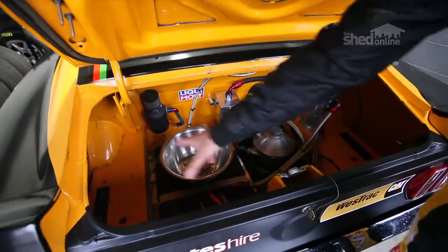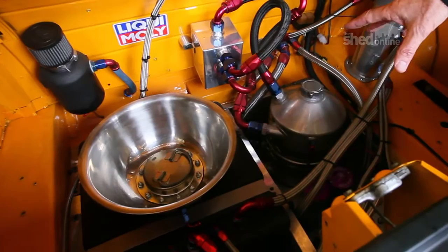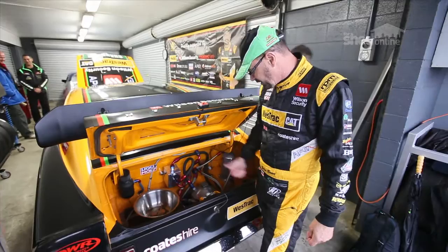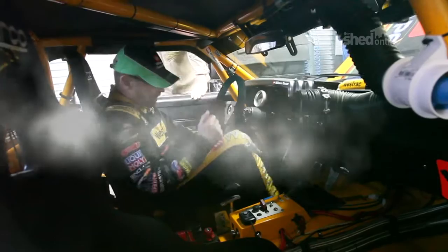This is the fuel and oil system. There's the fuel cell and this is the oil tank. The engine's dry sumped, so it doesn't carry any oil in the engine — it's pumped through, scavenged out, pumped through again. It's quite a nice system. The oil's carried in the tank, pumped to the engine, through the engine, back again, through the cooler and back to the tank.